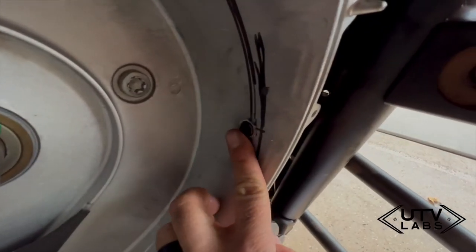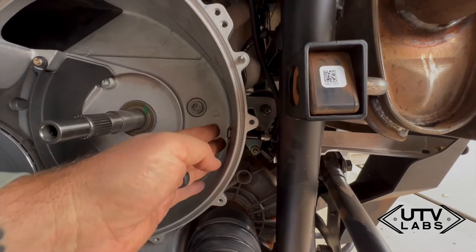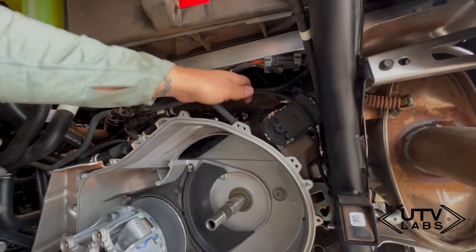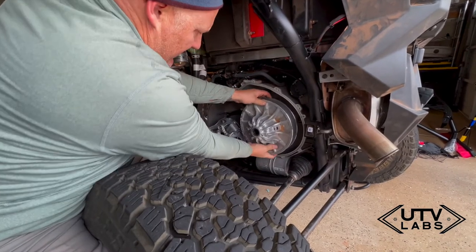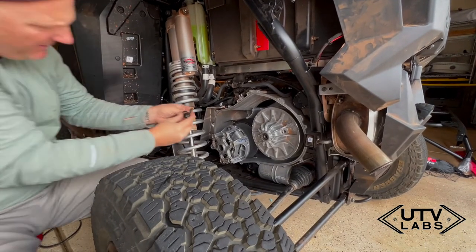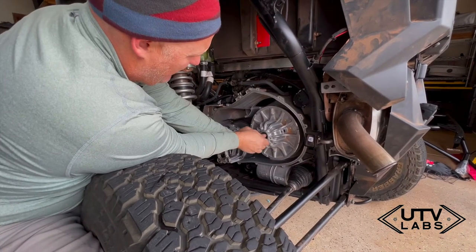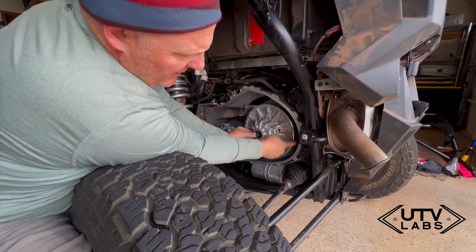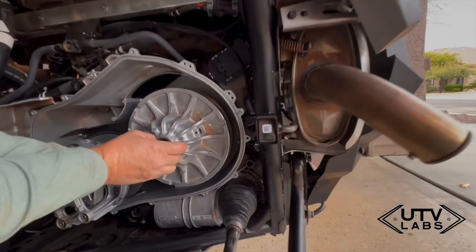The sensor is in there, just barely through the surface enough to get a few threads on it. The belt's spinning right here, so you don't want it to be too deep. Cables are run and zip-tied, and that's our install. We'll put the clutch pieces back on, then the belt — plenty of clearance. It's dead center on the belt, so the temp reading should be good.